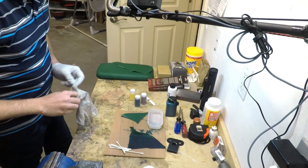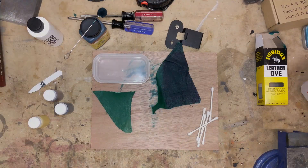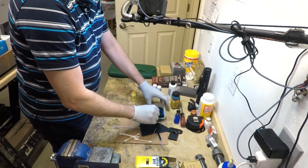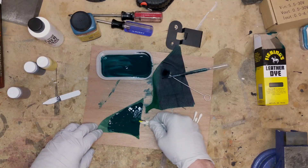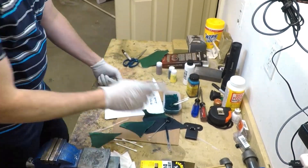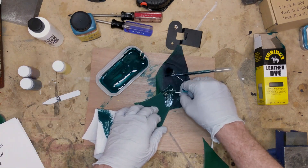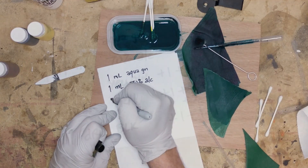We've got no reason to show you the full blending process in real time. Custom colors require custom mixing, and you'll need to eyeball your own blend. Do note that there are alcohol-based leather dyes, like we're using, and oil-based leather dyes — which we probably should have used for better colorfast properties in an automotive environment. Whichever you choose, keep in mind the two types won't mix. In fact, we found that different vendors' dyes of the same solvent base still had trouble mixing. The two big takeaways: get a set of pipettes from the hobby store for measuring out proportions, and write down each new recipe you attempt. If you don't, you will run out of that perfect mix midway through the job and never figure out how to recreate it.